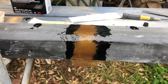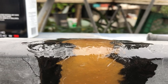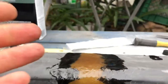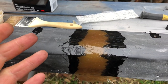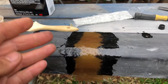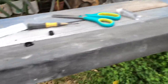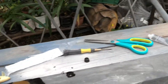Just like that, I'm done. I put a little bit more than I wanted to - you can see how it's rising up - but we can go back and sand it down. I only ended up putting two layers of fiberglass. Holding it up with just the back side, the fiberglass was already sturdy enough for the side skirt to flex a little bit. I'm pretty sure with doing this to the other side it should be more than enough to just stay situated on the side of the vehicle. We're going to put double-sided tape all along the rocker and that should hold it in place.